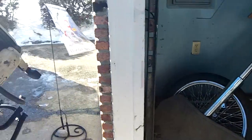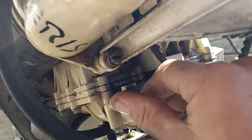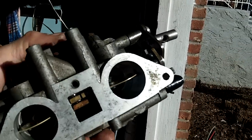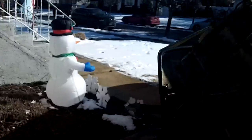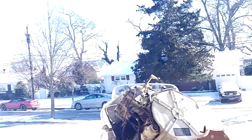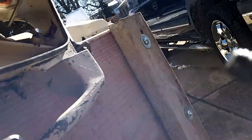The carb I took apart — I was putting these bolts back in just to keep track of them. This whole gasket was covered with gas and oil. I initially thought maybe I flooded it, and it looked like there's a little union on the bottom of the carb that was covered in gas and oil as well. I still couldn't figure out how it got under the gasket until I put those bolts back in — they look stripped to me. I'm thinking the carb was loose and that was the reason I wasn't getting the performance out of it.